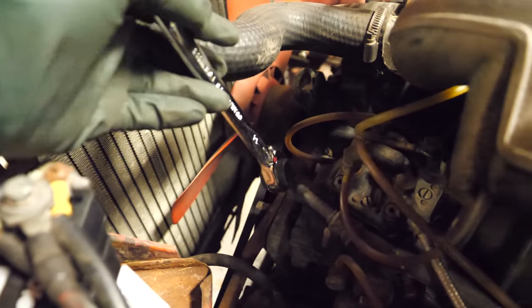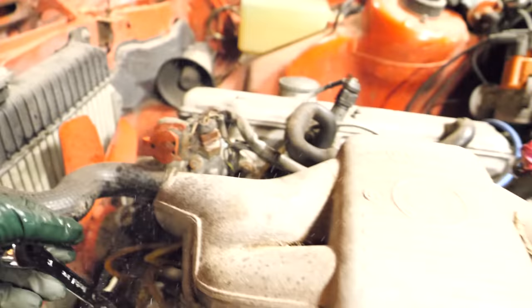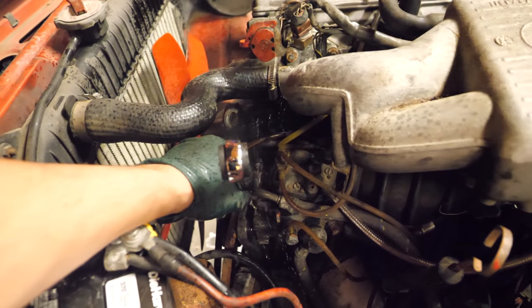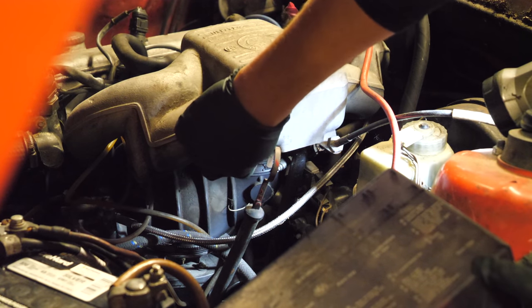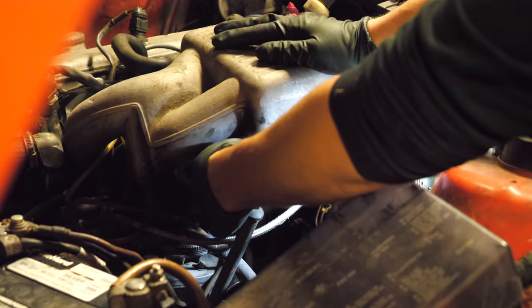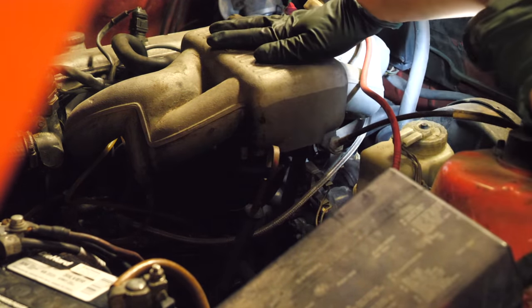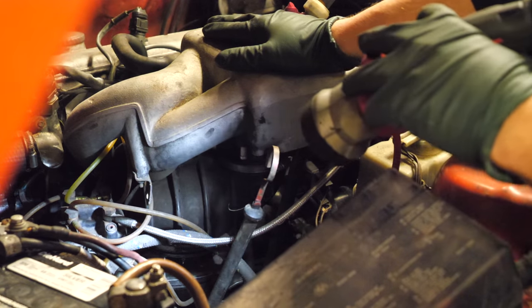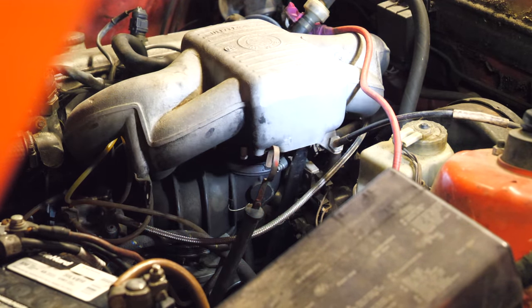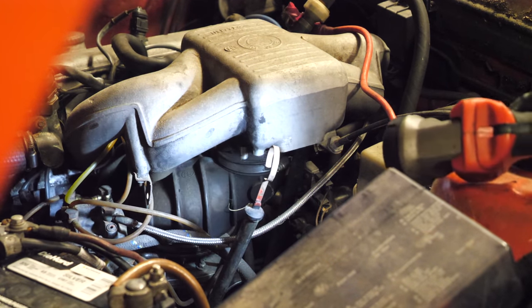It's got pressure. That was a lot of fuel and it stinks. Now I need to find something to plug up this vacuum nipple here. I looked around but didn't see any hoses coming off of anything that wasn't already connected. It's clear that this manifold must have been used in multiple different applications — maybe it's an automatic transmission thing, maybe a different year or different emissions, who knows. Let's get a cap on that and go from there.